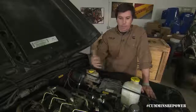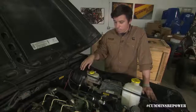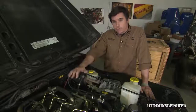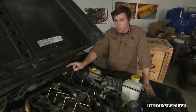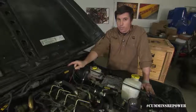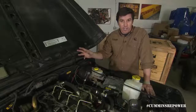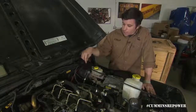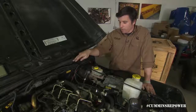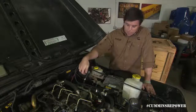A lot of diesels, like your big diesel pickup trucks and our 6.7-powered trucks, have hydro boost brakes rather than vacuum brakes. For the vintage vehicles we're targeting, not only were they vacuum brakes, but a lot of those interior climate control features were vacuum actuated. You can't really get away with just doing a hydro boost conversion and then have no vacuum anywhere. So we kept all the factory interior hard vacuum lines, any check valves that were in place, and ran a line straight to our vacuum pump.